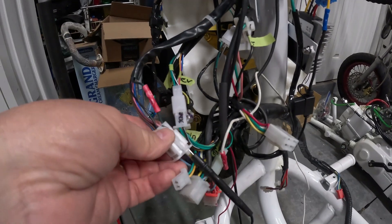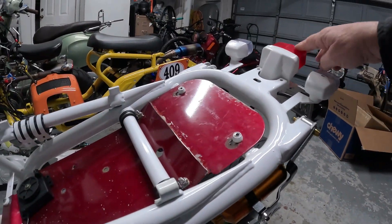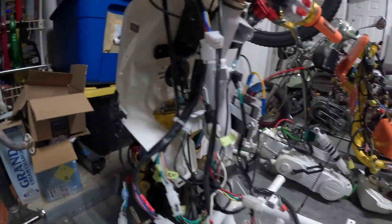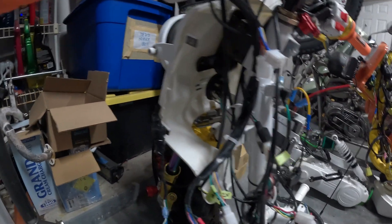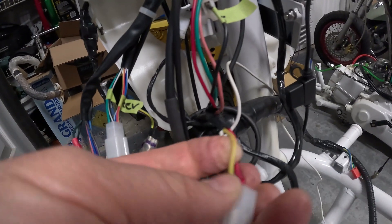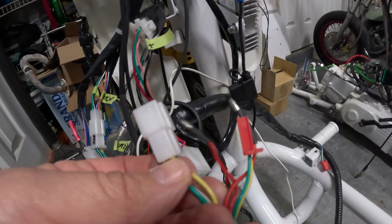One modification we're going to do is to the wiring on the original bike harness. If you have a Gen 1 and it's stock, your headlight and your tail light are going to work off AC power. Blinkers, brake light, and horn stay on DC power just like they always were. But we have these two AC-powered parts — the headlight and the tail light — so you're going to have to buy a DC headlight. The AC headlight just won't work. I'm going to replace the bulb with a DC bulb.